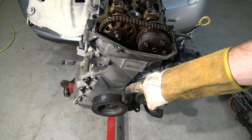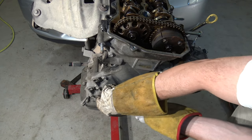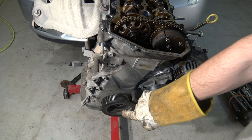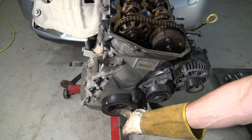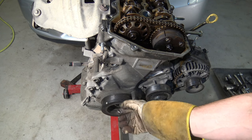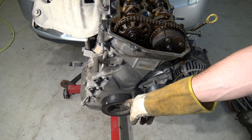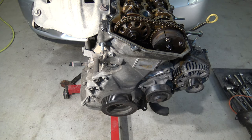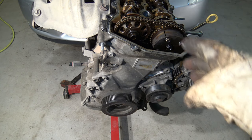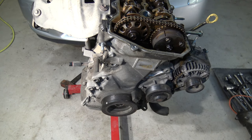This is the crankshaft pulley wheel, and we can also rotate this engine in that area. There is a big bolt in here, the crankshaft pulley wheel bolt, which is now away, but normally it is in position, and we can rotate this engine clockwise using that bolt. It is a good hint also. But the starter is also good. Okay, and then we go to the point of how to check that my timing is okay. Let's look at the upper area next.